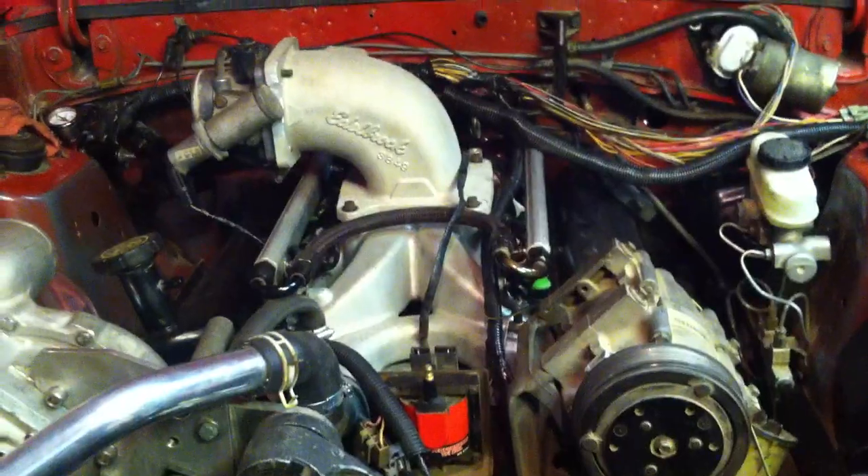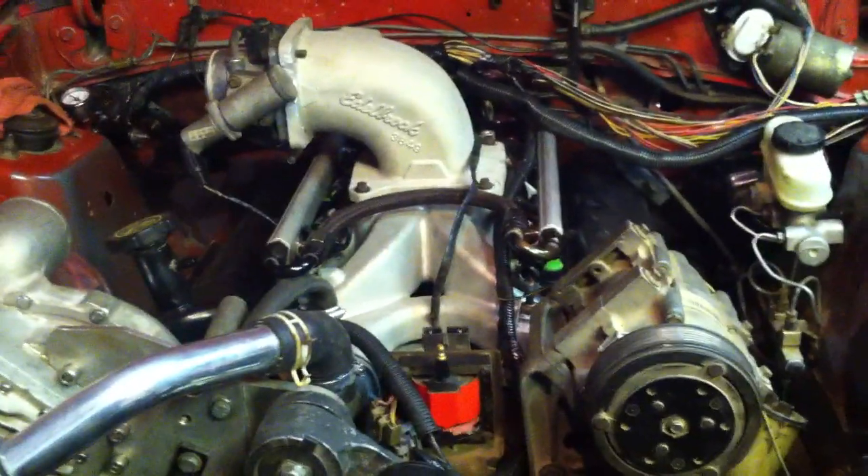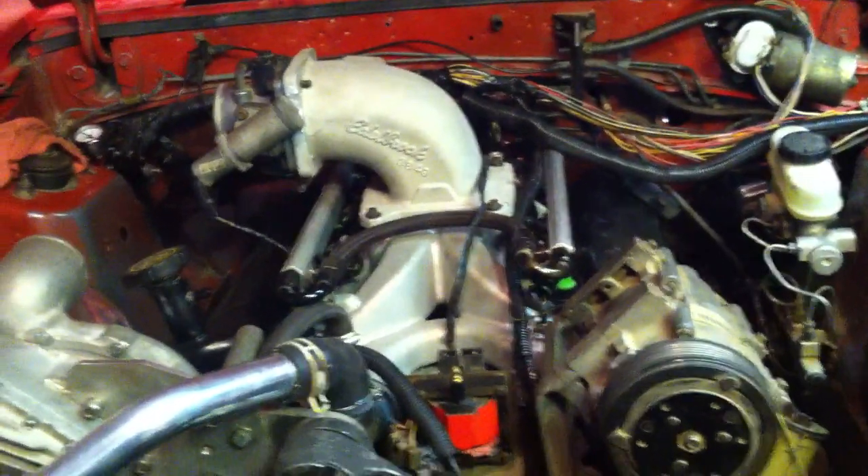You need to use at least a two-and-a-half or three-inch cowl. If you go fuel injected to get it under the stock hood, the engine mounts I used are made specifically for a 351 swap into a Fox Body — from LRS, Late Model Restoration Supply. It's a solid steel drop motor mount for a 351 swap. The other things you'll need are the 351 swap oil pan and 351 swap headers.